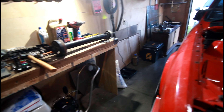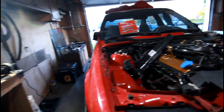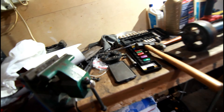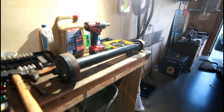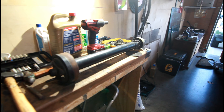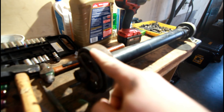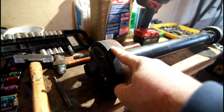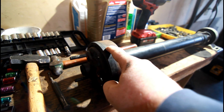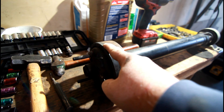I just wanted to throw this in since I just got done filling up the transmission with fluid, which was annoying — I had to use that little goofy pump thing. But anyways, this is the driveshaft that came with my swap. This came from an early model, so it has this little dampener balancer thing right here, and this is hitting the DSSR. So if you're doing the DSSR upgrade like I did, this is gonna have to come off.